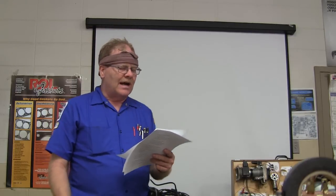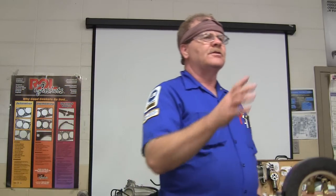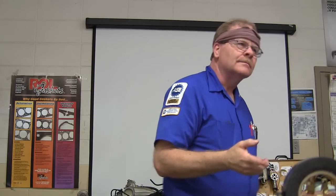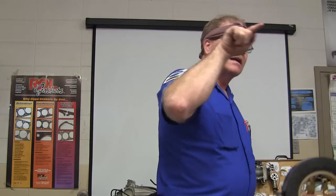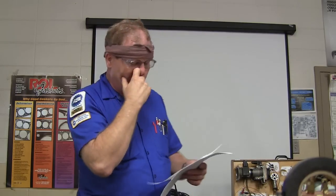What happens inside the torque converter at higher speeds? The turbine and the impeller spin at similar speeds. The turbine is the part that hooks to the transmission for output; the impeller is the part bolted to the engine. How does the torque converter lock up? Usually they have a clutch — there's pressure that applies it, and it touches the inside. That clutch causes the turbine shaft to be one with the engine all the way back. If it doesn't unlock, it'll stall the engine.